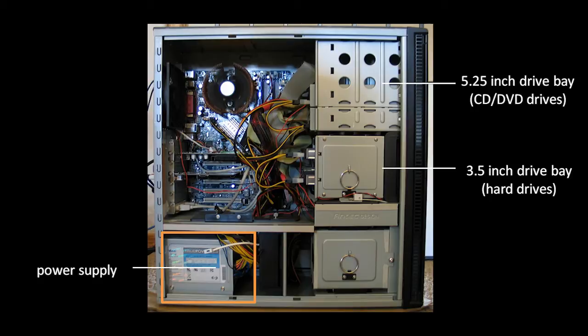At the back of the system, either at the top or at the bottom, you should have a box which is the power supply. The power supply is the component into which you plug the power cord running from the wall socket. Everything else in the system which needs power gets power from the power supply. The power supply is very necessary because the power which comes directly out of your wall socket is very erratic. The power supply takes that erratic input and converts it to a more regular, consistent power stream at the proper voltages for all the various components.